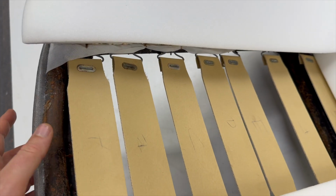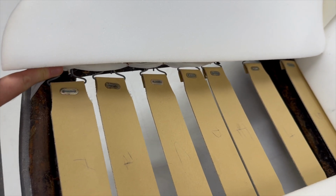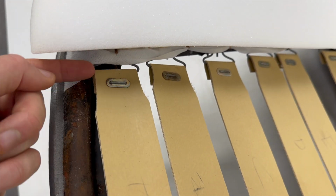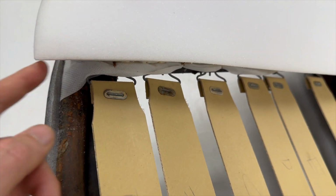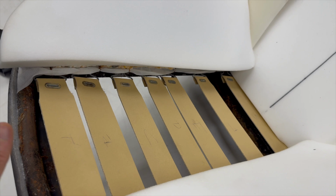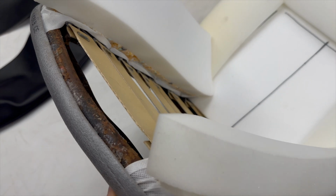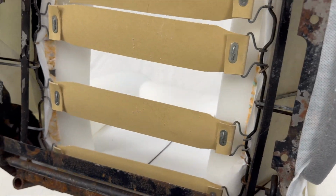It's worth noting as well, some of our Pirelli webbing is actually slightly too wide for the original clips, but it's very straightforward. You just want to be tapering it down, as you can see there, to allow for it. Do not just cut in, because that will rip the webbing over the course of time. But if you just gently taper it in, no harm done, and you're still remaining with the core strength there. It's something we've done for years by design, because it offers a better overall finish and product and longevity to the webbings. But obviously we've reused the original clips on those. We can offer the aftermarket versions if you prefer.